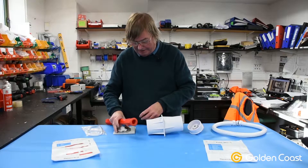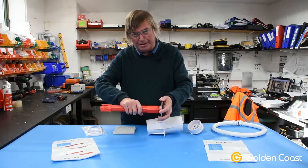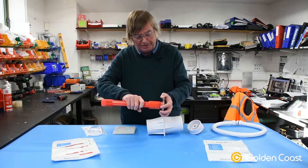The red nut is used for fixing the lamp into the ring. You can put this on the back of the lamp and twist it to get it tightly into the ring. Without this tool there's virtually no way of doing this without damaging the lamp.